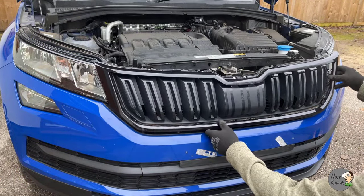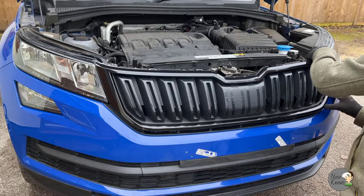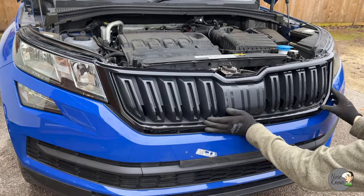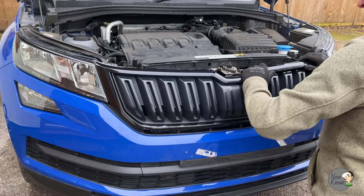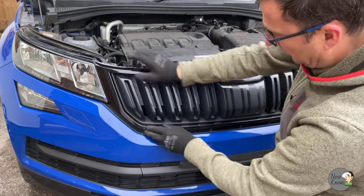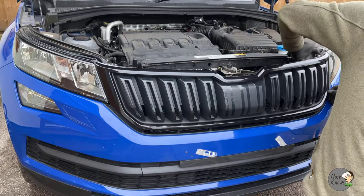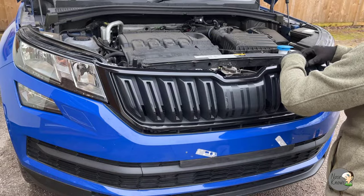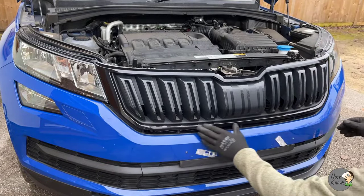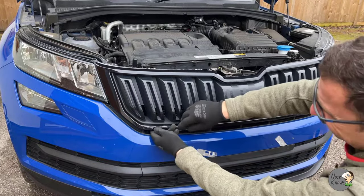This is the black one that's replacing it - we've already seen this and it now needs putting on. I've cleaned it down before clipping it back on. Offering it up - it is a cold day, about two degrees, nearly zero. I'm being a bit cautious; the engine is warm so there is some heat on the plastic, but this new grille has been in the cold. I'm clipping it on, making sure I get a firm click as each clip goes in. You can see it flexing at the top - be careful not to put too much pressure on it, since until you get the top scuttle panel back on for rigidity you need to hold your hand around it.